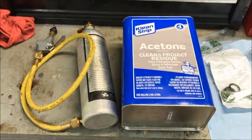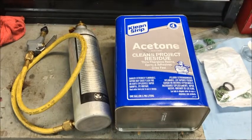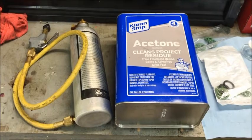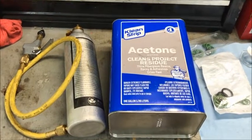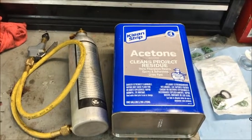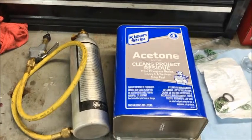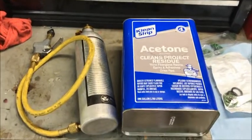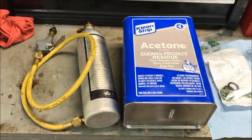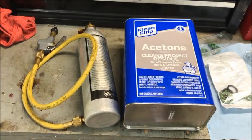So that's how you flush them out — you've got to do it. If you don't, the mineral oil used for R12 is not compatible with R134a, and it will prevent the R134a from picking up ester or PAG oil, which is what you have to use with R134a. The refrigerant gas actually carries the oil around through the system and through the compressor pistons. So if it's not carrying the oil, your pistons are going to go dry and your compressor will seize and fail. Make sure you get all that old mineral oil out before you convert to R134a.